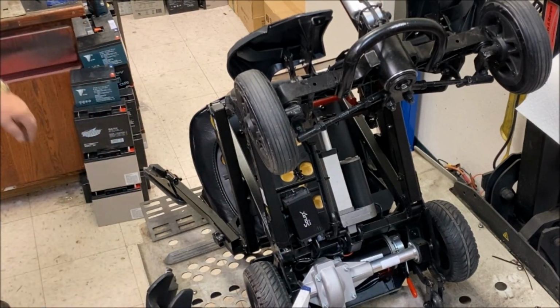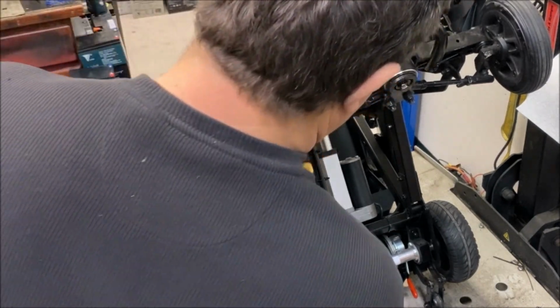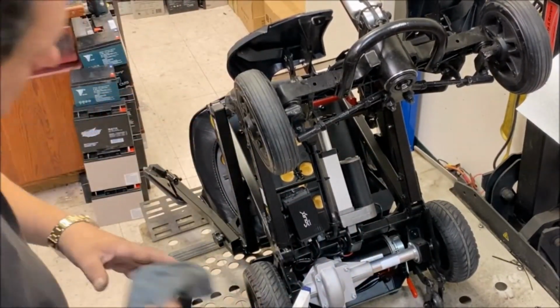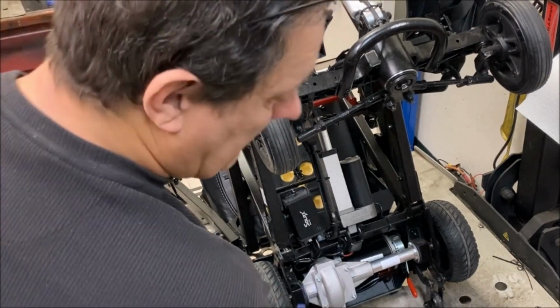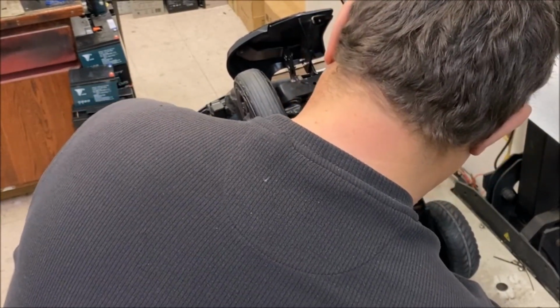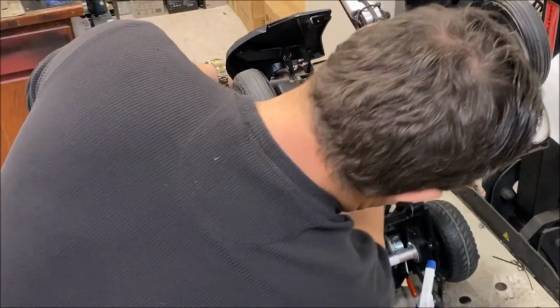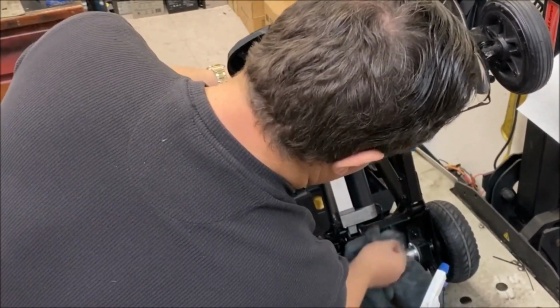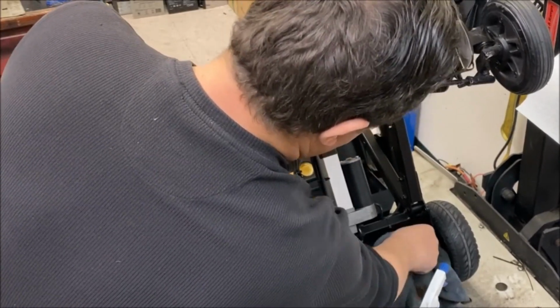Okay. So, there's a lot of exposed wires. And also your controller, your brake, you've got to be careful of this relay box and also your RAM. So definitely, if you're going to spray it with cleaner, cover everything up that you don't want to get wet. And just carefully, let it, and then just do it a little bit at a time. So you're not going to wreck anything, especially your brake.